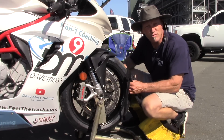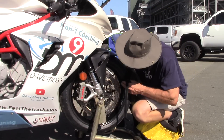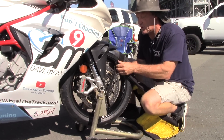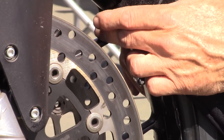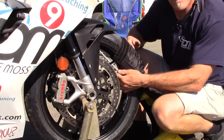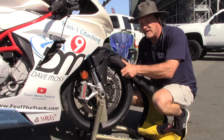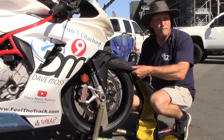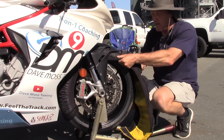Tire warmers — how should you put them on? My personal preference is to locate your tire valve and then put the warmer above the valve on the nearest spoke. It will go here and around that spoke and fasten it on that way. As you work the wheel around, you're going to use your knee on the wheel and pull the warmer tight. You don't want to pull against that rubber valve stem, so setting it against the spoke means I can pull this tight and stretch knowing I'm not stressing the tire valve.